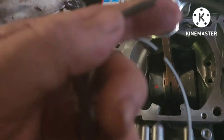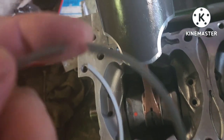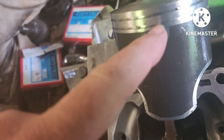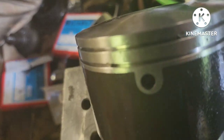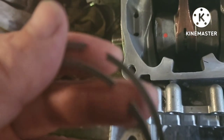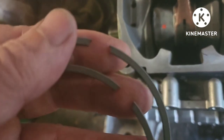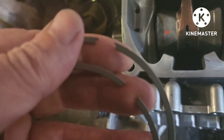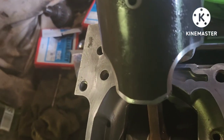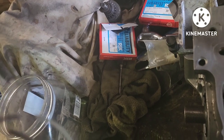These rings have got little locating pins on them. A lot of times rings will be beveled and you make sure the beveled edge goes down under the pin — but these don't have that. These have got a little cut that goes out around the pin. So the cuts align at each pin. Pop your rings on.